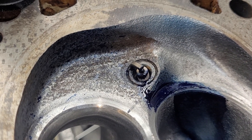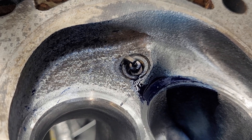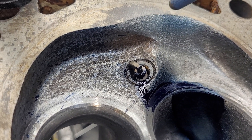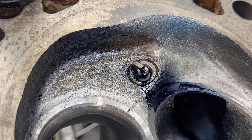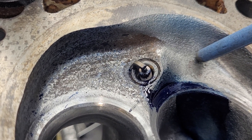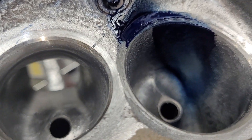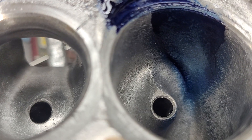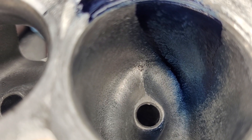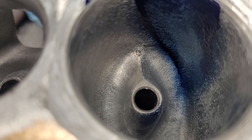We met with mixed results. This cut changed our flow numbers and it radically changed where our fuel went. If you look down the bowl, that roof is completely clean — that was not like that last flow test.